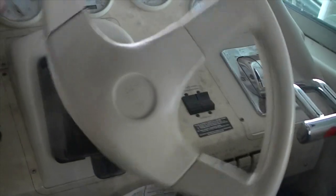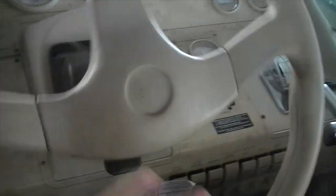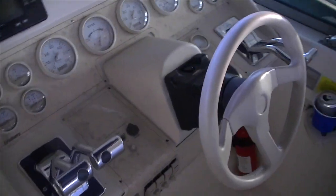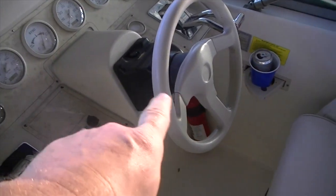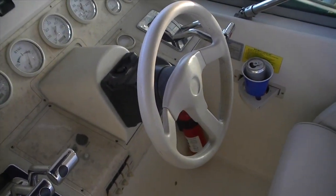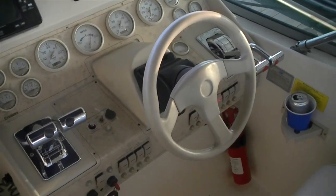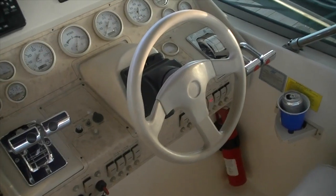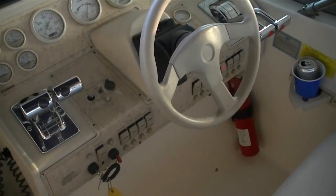You can turn it all the way one way and it'll stop — that means you've hit full lock. I had it out already and it worked perfectly. Definitely remember to put the power steering fluid back in it, otherwise it ain't going to turn. As you can see I got it all back together, took it out for a test drive, and everything was perfect — no leaking whatsoever out of the bottom, so obviously it was just a seal. Guys, pretty easy — about two or three hours of work to replace a complete helm seal kit in a Teleflex hydraulic steering system. See you next time!